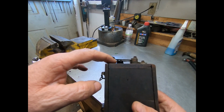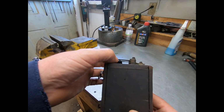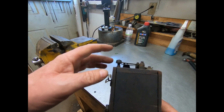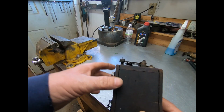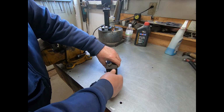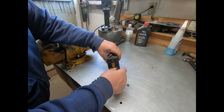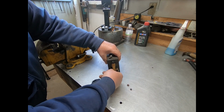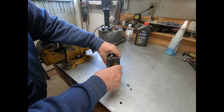And of course this will build and decrease that magnetic flux as many times as this thing here vibrates, and it vibrates fast. So I just went out and I put it onto my one lunger out there, and it won't buzz. So we're going to take a look at some of the points here and just see exactly what they look like.